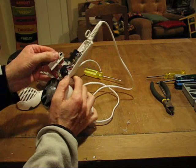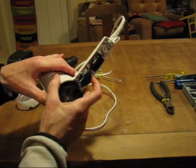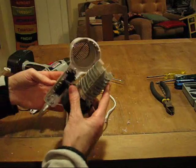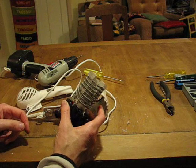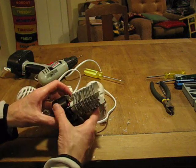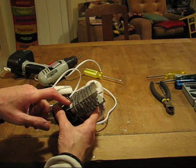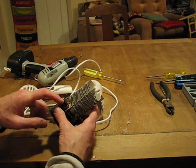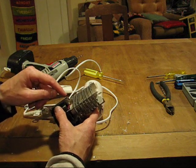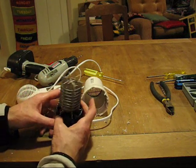So here we are inside. There are two switches — one for the fan speed and one for the heater — and there's the motor. The motor is surrounded by a heating element. The clever thing that almost all hairdryers do is use the heating element as part of the circuitry for providing 12 volts DC to the motor. They have a diode rectifier across the motor which converts AC to DC, and the motor is connected across enough of the heating element to provide 12 volts or 24 volts.